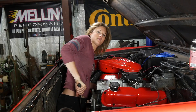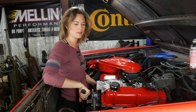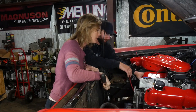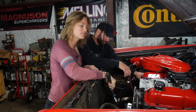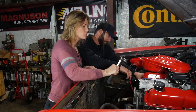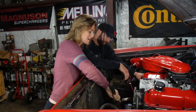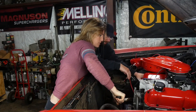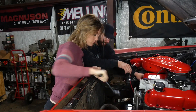I'm going to turn this thing and see if I can get top dead center. We want to stop it when all the air has seemed like it's squeezed out — that signifies the piston has gone all the way up. We've got a small screwdriver stuck down through the spark plug hole, and Aaron is going to tell me when he feels the piston has reached the top. Back up a little bit. That's it — that is top dead center.